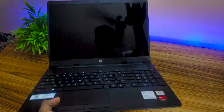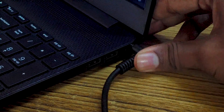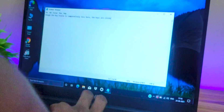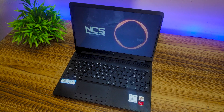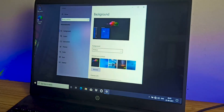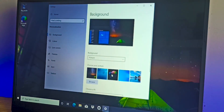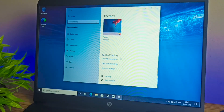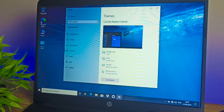The next thing to do is take a complete glance over your laptop. Review everything physically — check for physical damages, review the charger, check the power cord, check the ports around the laptop, plug in different devices and check if they work properly, check the keyboard using a keyboard tester online or Windows Notepad, and check the speakers. I've done a video before about this physical testing process so I'll link that here.